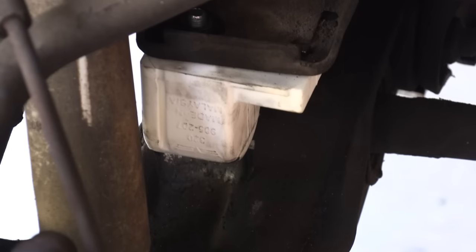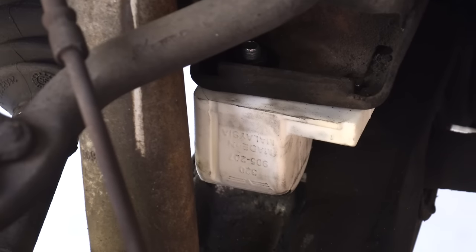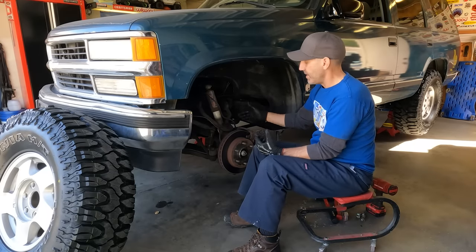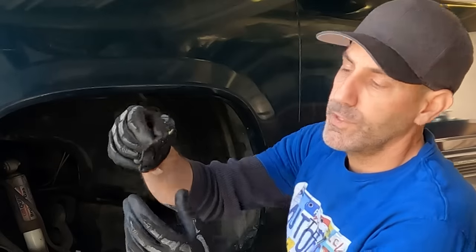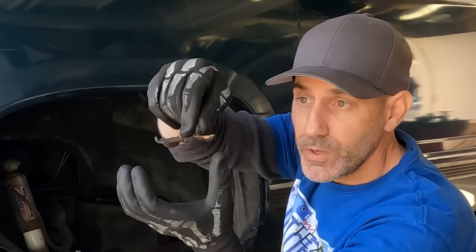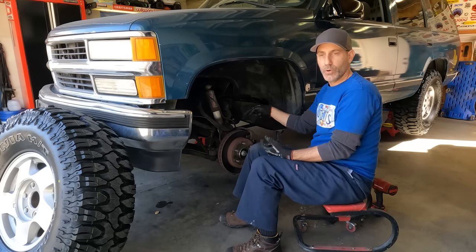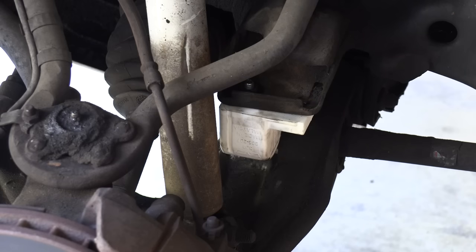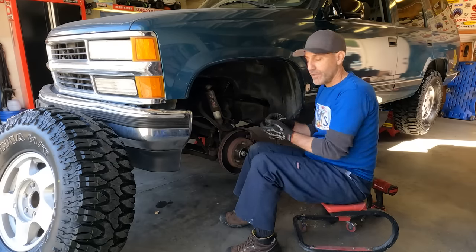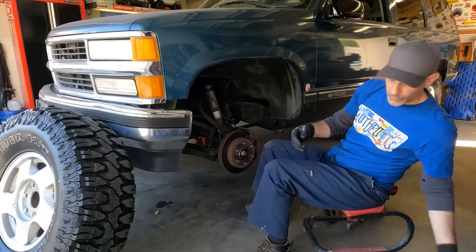Now I got these off of, I put a link in my Amazon store to these things, just the same with the Skyjacker ones in the rear, but I put stock replacement Dorman style inside there. But let me show you what this looks like. This is what the stock bump stop, there used to be an actual bump stop here, and you could see now what the Dorman product looks like in place there, and that will just help protect from the suspension over traveling and tucking up all of that fancy new rubber up into the wheel well that we don't want.